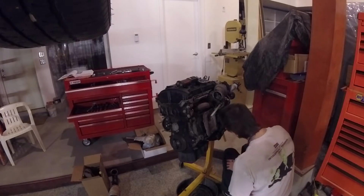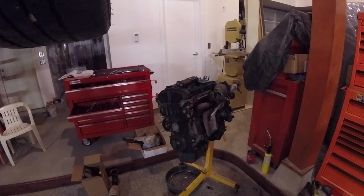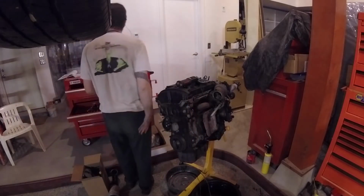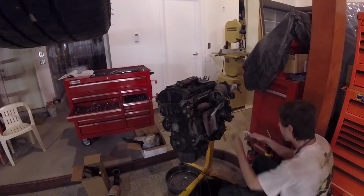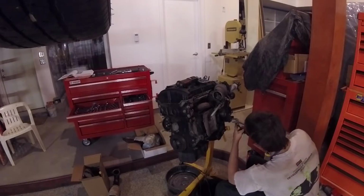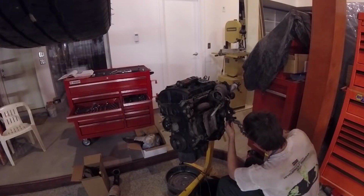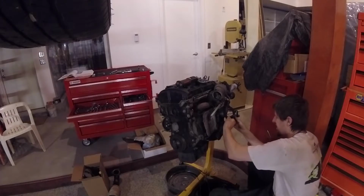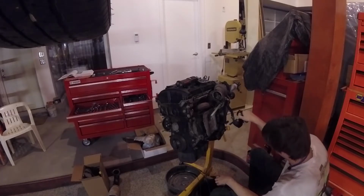Yep, see, there it is. There's the water pump. It just pulls out of the thermostat housing and then shuffles it through the water pump and back into another port on the thermostat housing, I believe. There's a couple baffled chambers in the thermostat housing. Okay, and yeah, the channel locks for getting the hose clamps off. These use a constant tension clamp, which I like. I just didn't have constant tension pliers for them. Yep, see, a little bit of coolant in there.